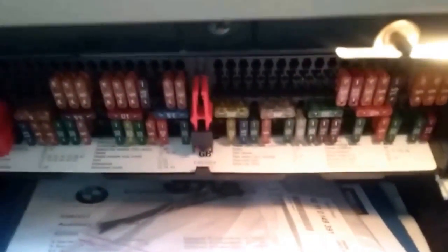We're also gonna need the 13 millimeter wrench. Then we need to go to our glove compartment, where we'll be doing a lot of work, and locate your fuse box. When you open your glove compartment it'll be pressed up, but there's a white clip right here that you turn — see, turn that clip and your fuse box drops. We're gonna be going through these fuses one by one, pulling them and using my multimeter to see if my amps change. Let me go ahead and hook up the multimeter and then I'll get started.